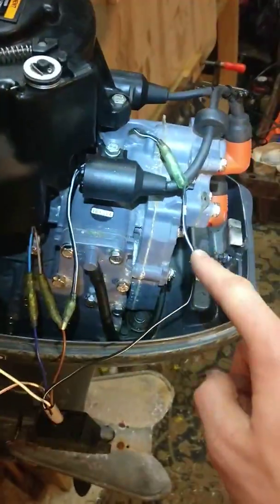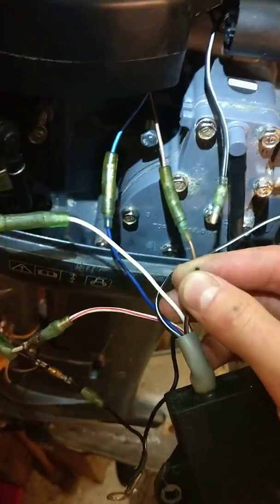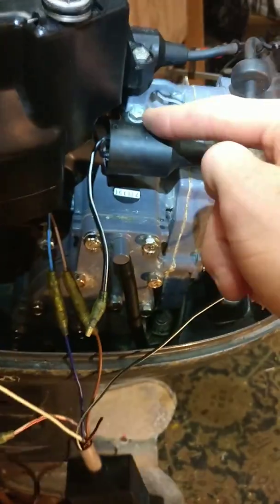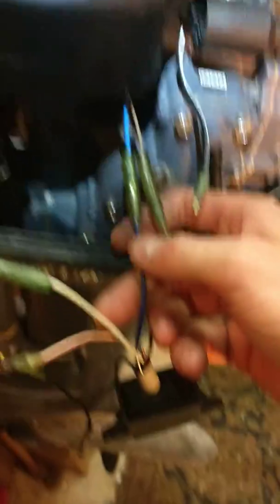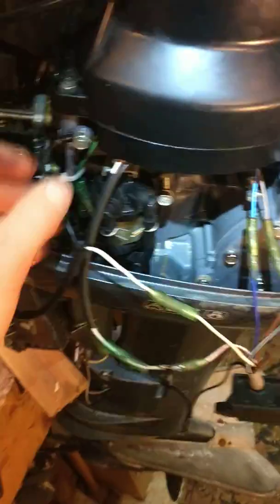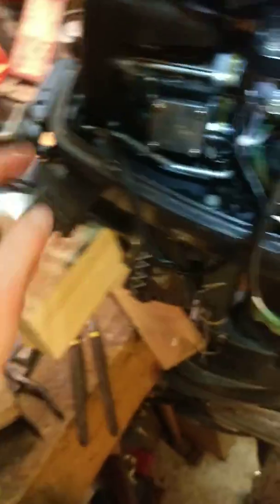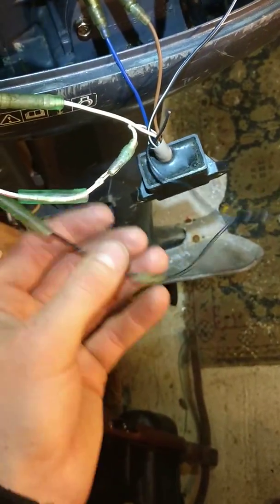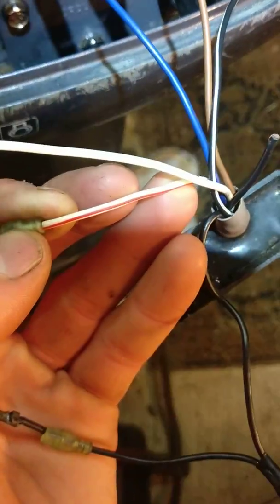White and black wire to white and black. Your orange and black wire on the new unit will also plug into a white and black, however it will be the closer of the two spark plug cables on the side of the CDI unit. Match the colors: brown with brown, blue with blue — that's for the main charging power source. Your pure white wire is for the cutoff/kill switch. Make sure the ground wire is in place, and ensure the pulsar coil is connected to the ground of the CDI unit and the red and white wire to the red and white wire of the CDI unit.